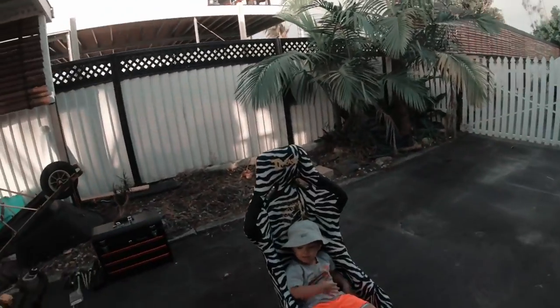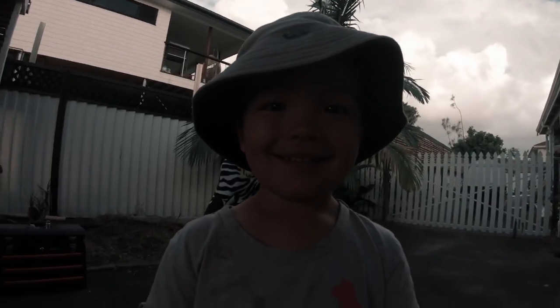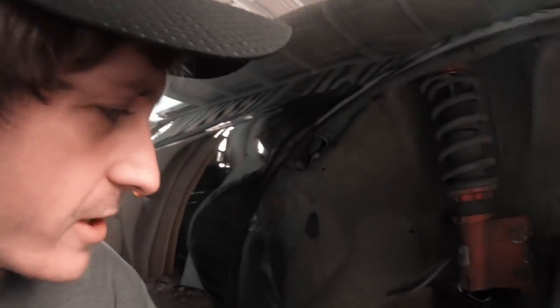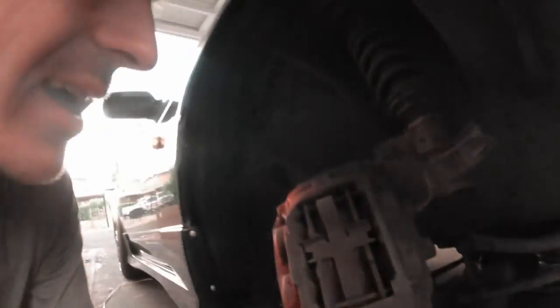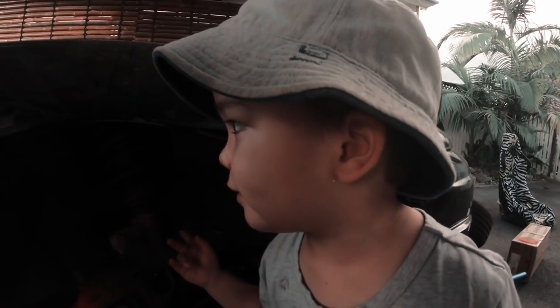Should we open the box? Nox is excited — this is YouTube, adults edition. I'll go through the tie rods quickly — I was meant to film it but got stuck on the tie rod. It's pretty much ready to come out except for that tie rod; I didn't have a shifter big enough. I don't think the car needs to be lifted once I get the LCAs back with the fresh ball joints — I'll get everything out and put the new stuff in.